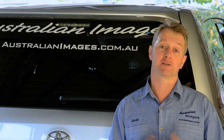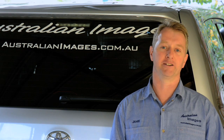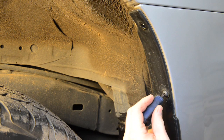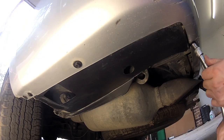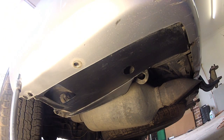Please enjoy our step by step guide as we install the Outback Accessories rear bar with twin wheel carriers onto the 200. The first step in the installation is to remove the existing plastic bumper. Begin by removing the screws securing each rear mud flap inside the rear guards, then the three bolts attaching each plastic splash guard underneath the bumper wings.